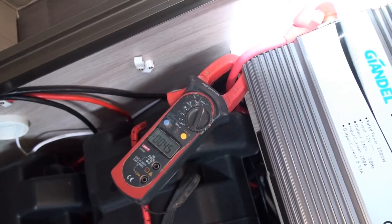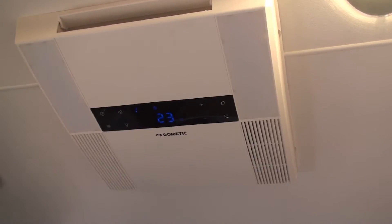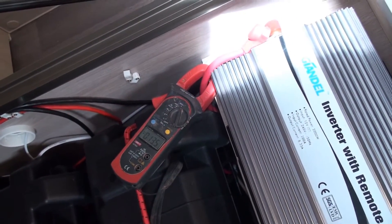Time to test it — if you don't have one of these, get one. It's on idle at four and a half amps. Let's turn the aircon on. Alright, so this is one of these new Dometic ones. I'll just set it at 23 degrees. Let's see what current that's pulling. 13 and a half amps — that'll go up.